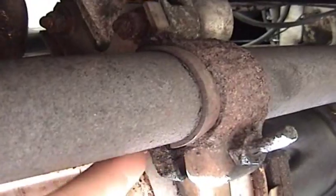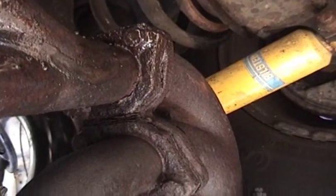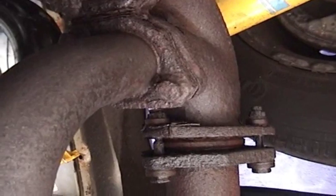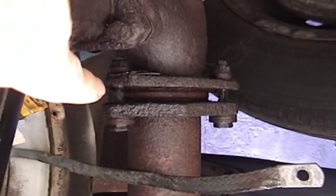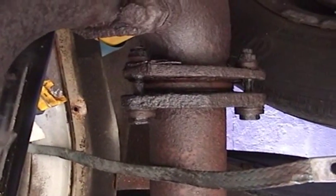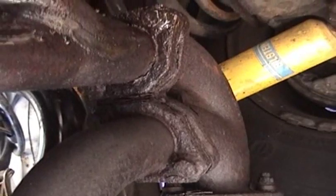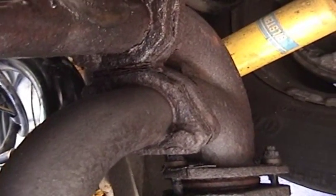The exhaust is not quite ready to come off the engine yet though. I got all the bolts loose in this mount right here. I'm really not sure about this clamp here — I may need to cut this bolt; it's hard for me to see exactly what this clamp is gripping on to. The same drain plug is on the other side of the engine. There are a couple of exhaust bolts I'm going to have to grind or cut off. I may need to cut through these three here where this pipe goes to the catalytic converter, or I may just cut them anyway to get more clearance. These four bolts holding the two manifold pipes to the collector are going to be a bit of a problem.